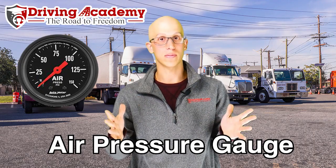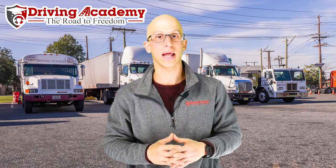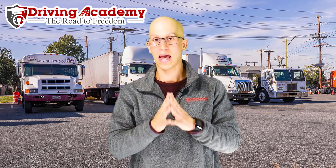The last gauge you're going to have to talk about for your dashboard is your air pressure gauge. During the in-cab inspection, this air brake system is extremely important because it runs on air. When you turn on the truck and the engine starts going, your air compressor starts kicking in and your air pressure gauge should be rising up, which means when you have air, you can move the vehicle. If for any reason the air pressure gauge is not rising up, either the gauge is faulty or something inside the engine is faulty — maybe a bad air compressor or a major leak. If that's the case, you will not be able to move the vehicle because your brakes will be locked.